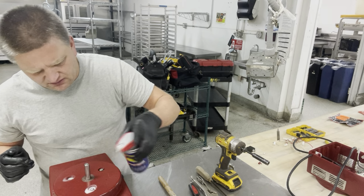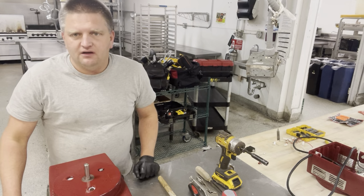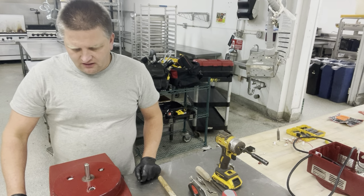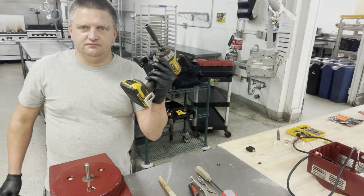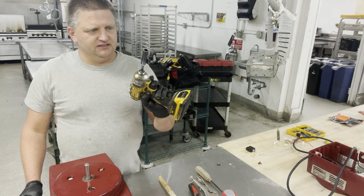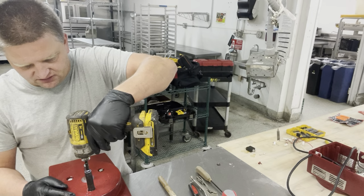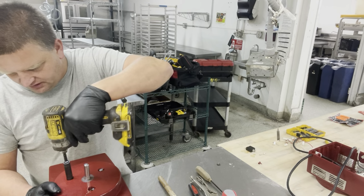important. Those bolts have been sitting here probably for 5-6 years without any lubrication. They're probably stuck in there pretty well. So I prefer using your electric impact wrench. As I say, a 7/16 socket, you put it on the top of the unit and crack those bolts right out. Most of the time they don't really hold that hard, but you never know.